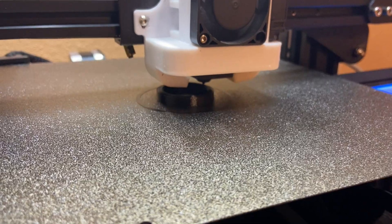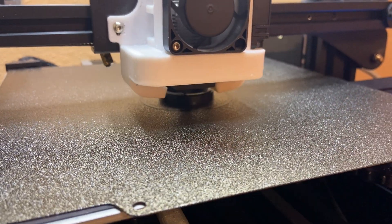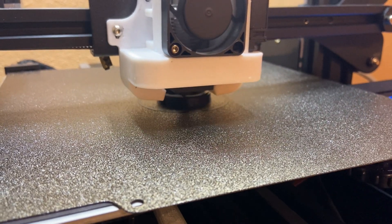So I got thinking: can I just 3D print a new boot? That's what I'm going to try. I loaded up Fusion 360, took a few measurements off of the tie rod, and modeled something up real quick. There it is — it's printing, it's been running maybe 10 minutes, and we'll see how it comes out, how it fits, how it looks when it's all back together.